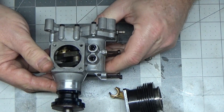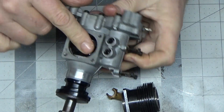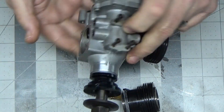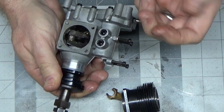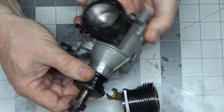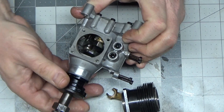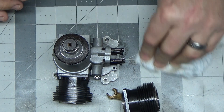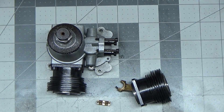Other than the connecting rod, the bearings feel fine — this engine is in decent shape overall. There's plenty of oil in here; there was oil all over the box it was stored in, so it was not a lack of lubrication by any means. Everything in here is very oily and still well lubed. In my estimation, this is not a result of a lean run at all. This is just a connecting rod failure, plain and simple — I've heard of several instances of this.